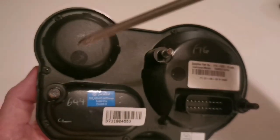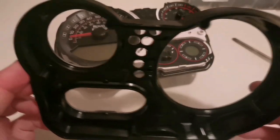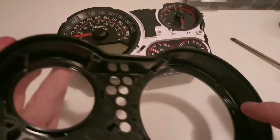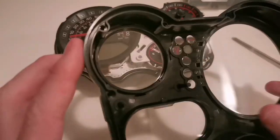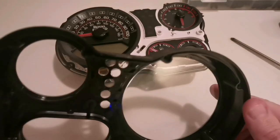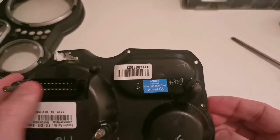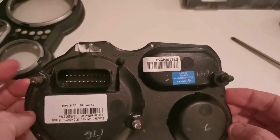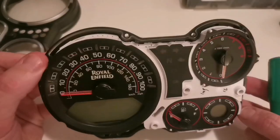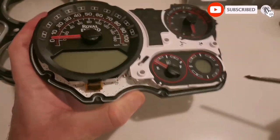On this side you'll see that there's several little screws around here, so I've got to be careful when I take this apart. It doesn't take a lot of moisture in here to get that condensation — as soon as that temperature shifts you're going to get some. But this seems to be completely sealed. It's entirely possible there might be a little bit of glue missing somewhere, but I really don't think so. These silver bezels are on the outside — they're clipped on. Looking for any areas where moisture might get in. The gasket in here seems to be of a sort of foam material rather than rubber, and to be honest I think that's probably your weak point.